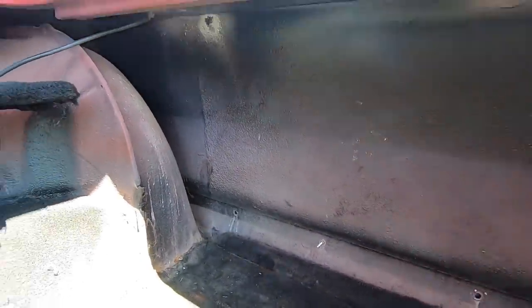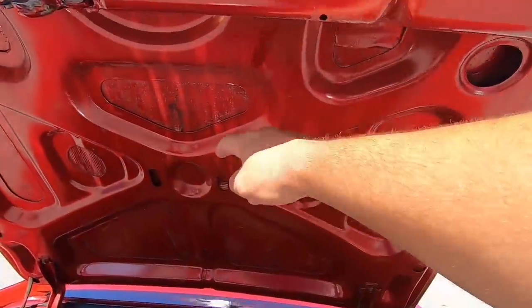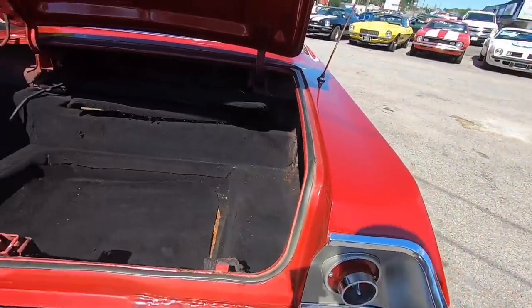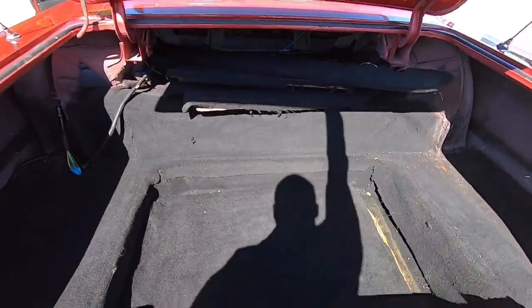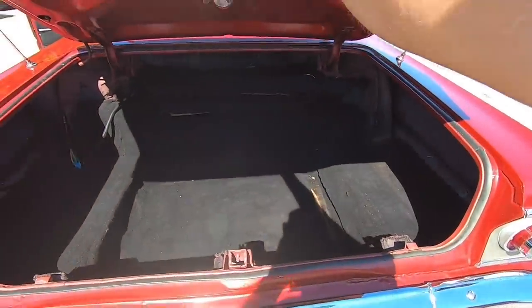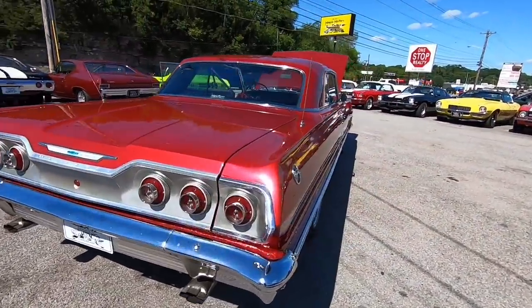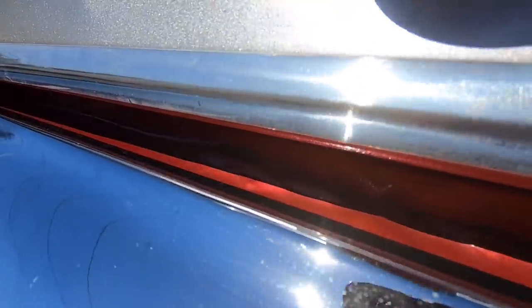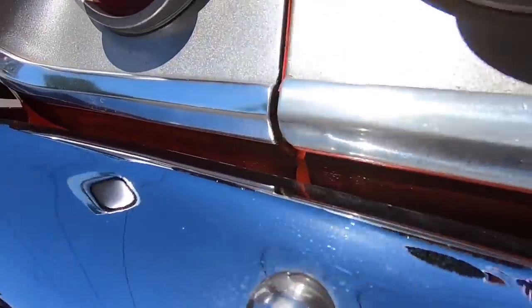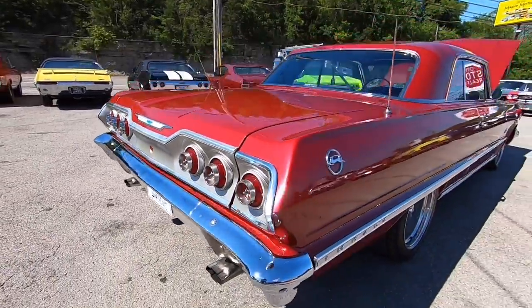Can't see anything on this back side, we'll check over here. It's a huge trunk though - did have insulation up here but it fell down. The weather stripping has been replaced and it's actually dry, so they could have replaced the weather stripping and stopped all the water leaking - that may just be older rust. Looking down in between the bumper you can see all those bubbles popping up. Same kind of stuff on this side, but I definitely want you to know about it.